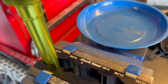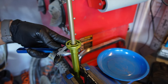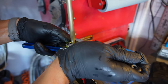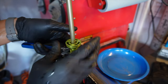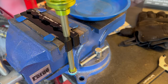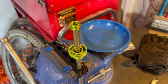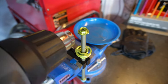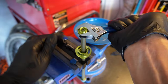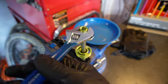Now we can move on to the damper assembly. Clamp it in the 20 millimeter part of your vice clamps, then use a wrench to secure the lower portion and pin spanners on the stanchion plug — using opposite forces to break it free. Once loose, remove the rebound shaft. Then clamp the rebound shaft in the 10 millimeter part of the vice clamps and remove the end plug. It's Loctited in place, so apply about 10 to 15 seconds of heat evenly around the perimeter to soften the Loctite and allow you to break that end plug free.